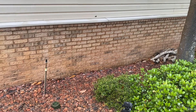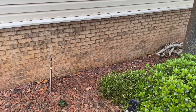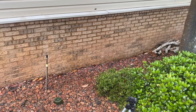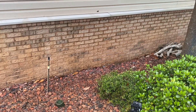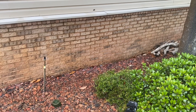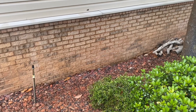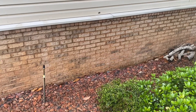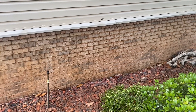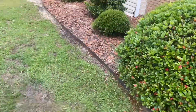We're back. We treated this spot and the other spot — all the rust was right in here. We treated it with Rust Remedy, applied it, let it dwell, kept it wet for 10 to 15 minutes, and then rinsed it off with the pressure washer. We used the J-rod tip for an 8-gallon-a-minute pressure washer. We found we just don't really need to change out tips a whole lot, and it looks amazing.